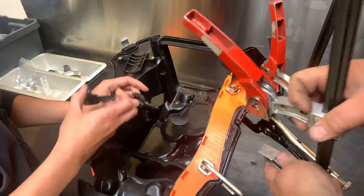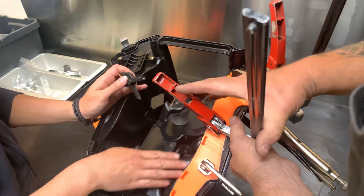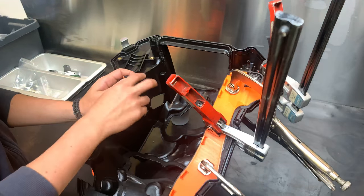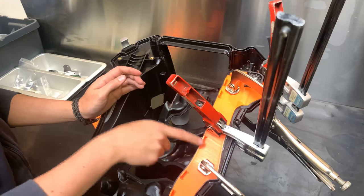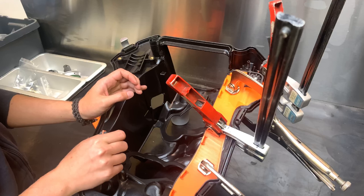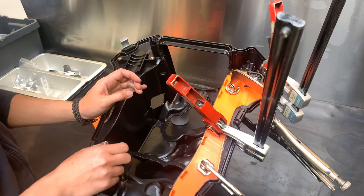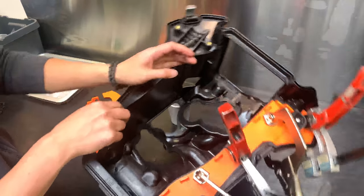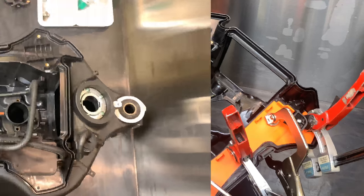You can just put as many clamps as you can get there to make sure that it's tight everywhere, all the way down, even here. And if you're using the two-part version, which has the puzzle piece here, be sure that both sides are very well clamped there. So try it out once dry first, so you know where the clamps are, because if I take away my hand now, that will happen, and you don't want that happening when you have the glue on.